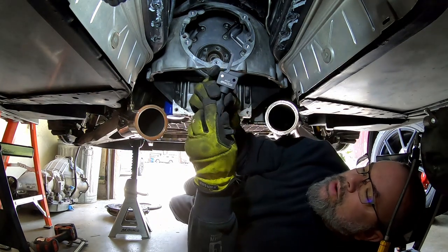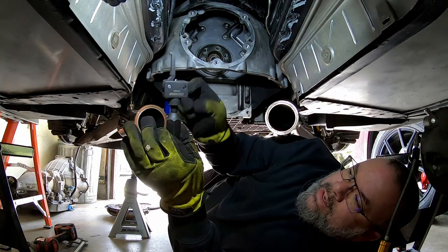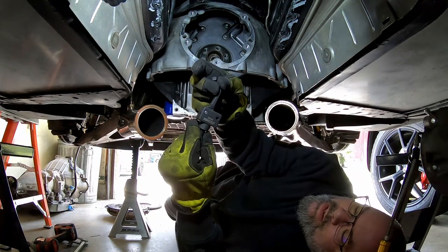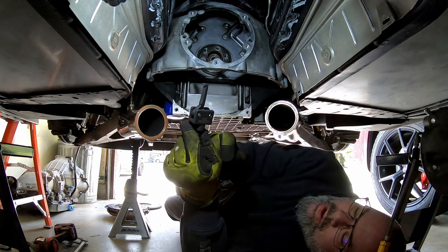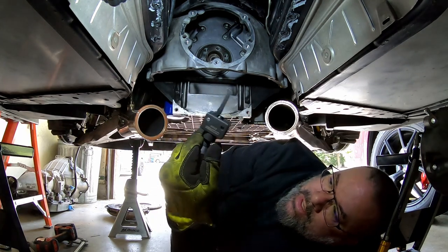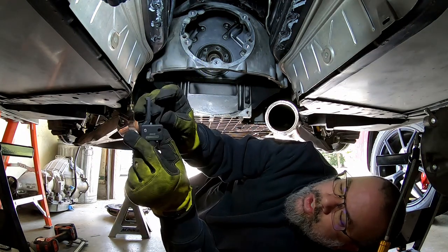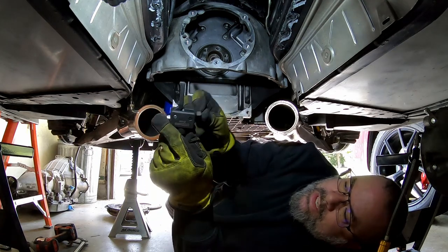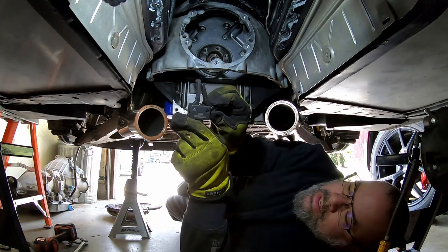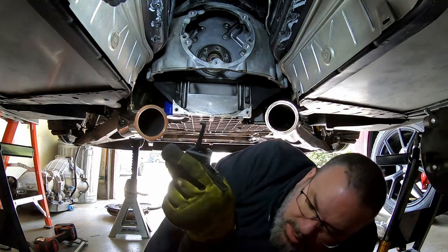So I got one of the OEM tool pilot bearing removers off of Amazon. And a lot of people said that the jaw height is too tall to get into a Corvette pilot bearing. So a lot of times what you can do is punch one of the pins out and take one of the jaws out, slip this one in first, and then weasel this guy in there next to it, and then squeeze the pin back in, and then take the pilot bearing out.